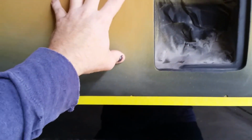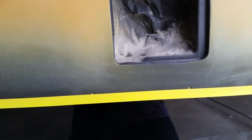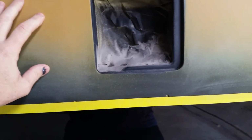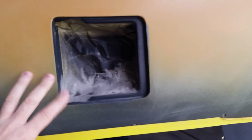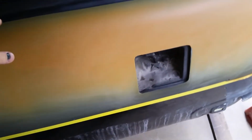But anyway, I'm going to mount the gas door and block this all together, because I did put a couple of coats of Z-Chrome on the gas door as well. So I'm going to make a run to the paint store Monday, and there's a couple more things I want to get, but I do plan on possibly Monday, because I'm letting this cure out quite a bit. I like to let my primers cure out in between, instead of treating it like a collision and just loading all that fresh stuff up on top of each other and then it's shrinking later. So Monday I plan on going to the paint store and then coming back. I'm going to mount this and then dry block this whole quarter area here. Then I'm going to go back and mask it off again and 2K it.